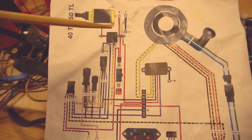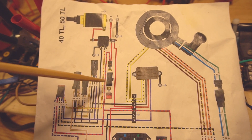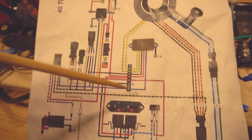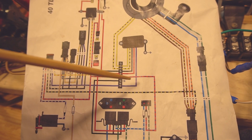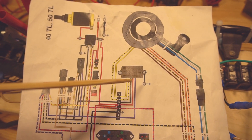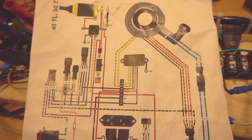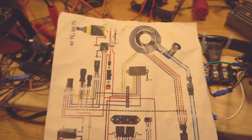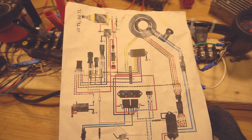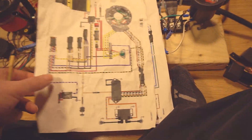I even have some wiring diagrams here. Here is exactly what I'm talking about: the power connects to the solenoid, runs to the fuse from which the cable runs and then splits into two — one going back to the controller and one running here, connecting to the panel and running to the switch for the trim up and down. Here you can see the regulator — the red wire from this connects to the other cable which runs to the same location on the solenoid but is not protected by a fuse. I have two diagrams: one is for an older version that does not have any trim, and this is for a slightly newer one.